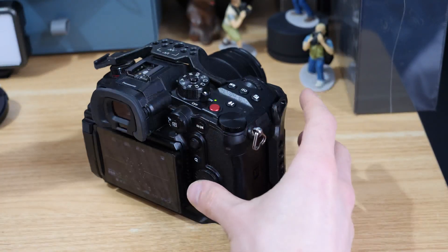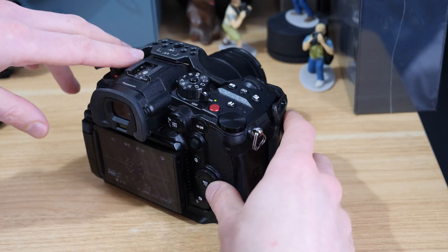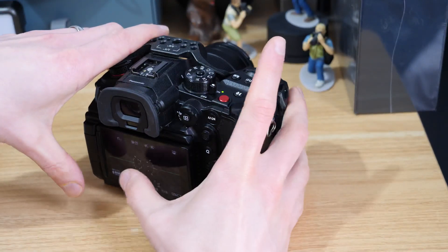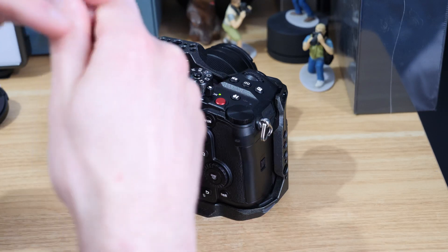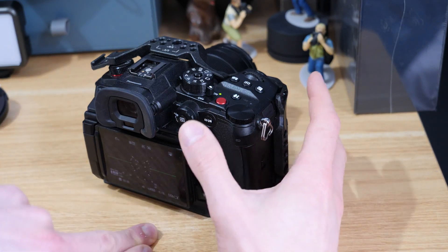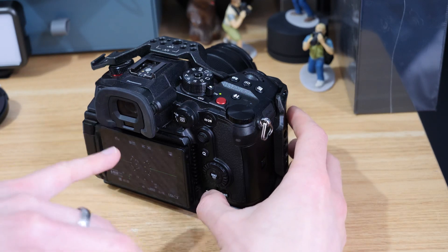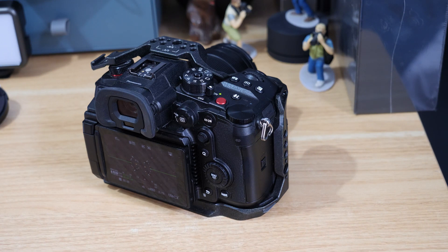With any luck that should eliminate the pixels that have gone wrong. If it's still there after that, it could be a problem elsewhere — it's always worth checking whether it's actually on your monitor, since screens can get dead pixels or stuck pixels too. So you really need to check: take the footage off the card, check it on a couple of screens, and make sure it's actually from the sensor. Your LVF and the screen on the back of the camera can make these things really hard to spot, so if you're seeing something noticeable on the screen it's more than likely on the screen itself and not burnt into the footage.